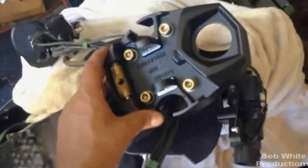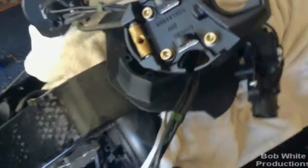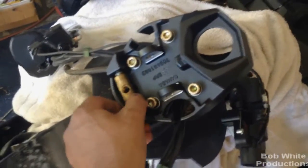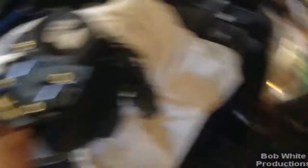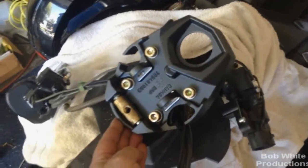One last thing about this step — there's slop in the holes, so you probably don't want the base sitting crooked, or your steering might be a little off. You can bias it up or bias it down so it's not twisted. The manual doesn't say anything about it, but I'm biasing mine up when I tighten. It's not a whole lot of movement, but it could show up in the handlebars not being straight, which might throw someone off when eyeballing alignment.